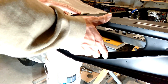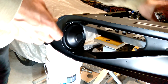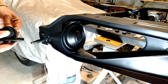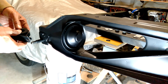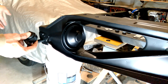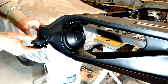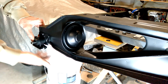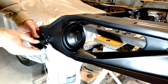This is the left side of the subframe — just keep in mind it is upside down on the bench. The way these trunnions get installed: the rubber bushes sit in there and I'll put a bit of grease on there. The taller side goes towards the back of the vehicle. That end is towards the front, so it will be bolted on like that — it bolts to the underside where the tray is, or to the boot of the car. Keep in mind the subframe is upside down, but that is the position it will go.